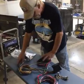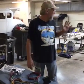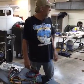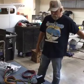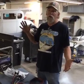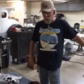Basically, it's kind of loomed up. Spend a little time thinking about what you want to have, how you want to run it. Are you going to use, I'm just thinking brakes. We use all the time a pressure switch for our brakes, which is down along the frame just to the back of, so if you're sitting in the driver's seat here, it'll be over here. Where your wires coming down out of this kit are going to be two short wires, an orange and a yellow wire that would come down to a mechanical switch that your brake pedal would push in. We don't use that. We just add some wires, come down around, and go to the back.